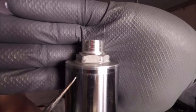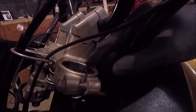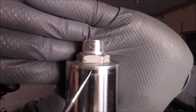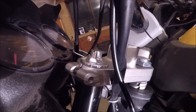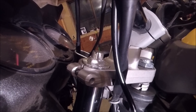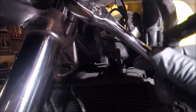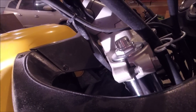When you put these back on the bike, you want the top flush with this part here — not here, but right there. Loosen it just enough to where you can move it slightly but it won't fall out, and line the top up just perfectly. Tighten it back up again, and do the same to the other side. That looks perfect right there.